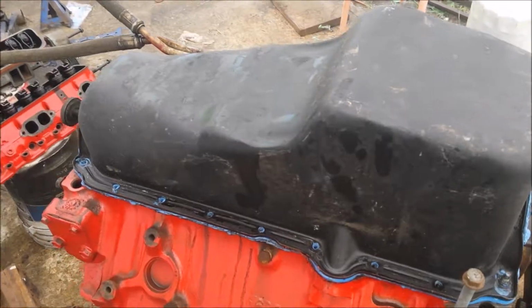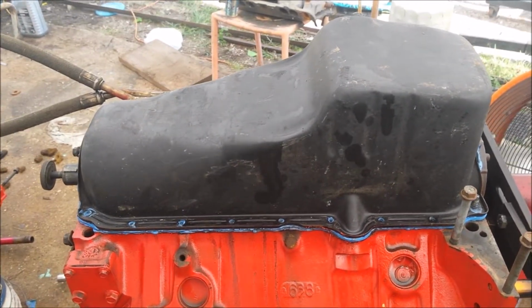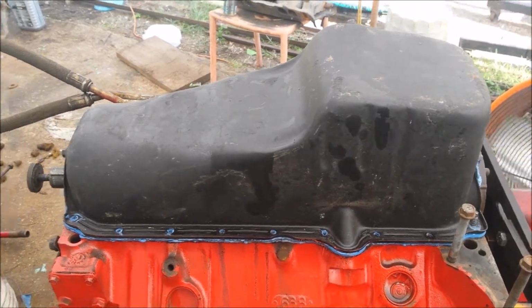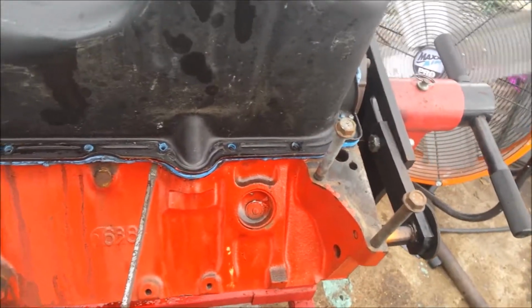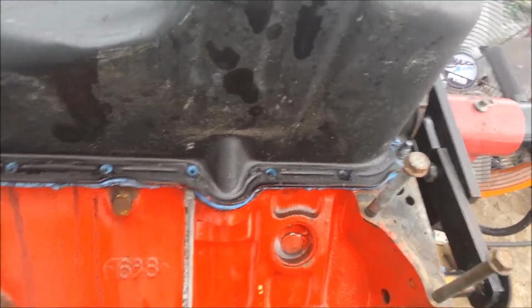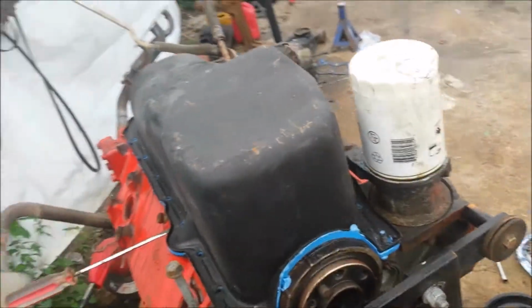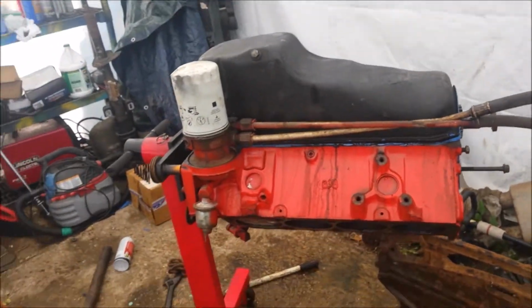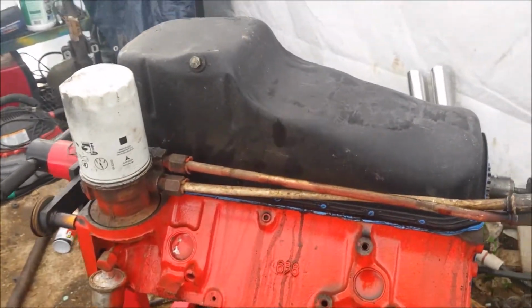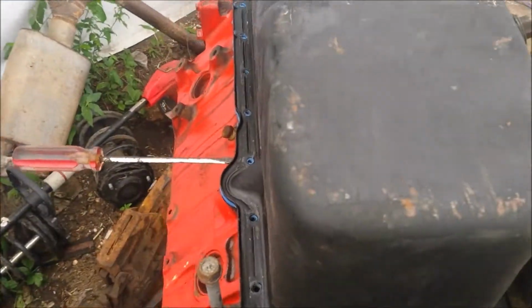So yesterday I made a mistake when I said forged pistons. They're just basic replacement pistons. They're dished, which is great. Basically, they give me a low compression, not that low, still better than factory, but not some awesome piston heads or anything. 60 over is definitely going to give me a lot of volume to be able to move a lot of air, and the new cam is definitely going to allow me to move a lot of air. So it seems like I might be accidentally building an engine that could take some boost.